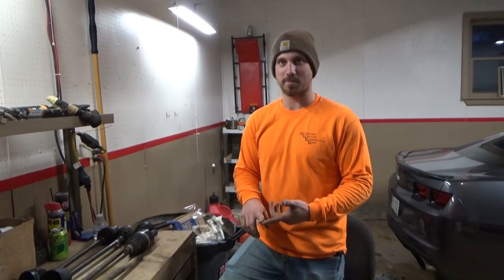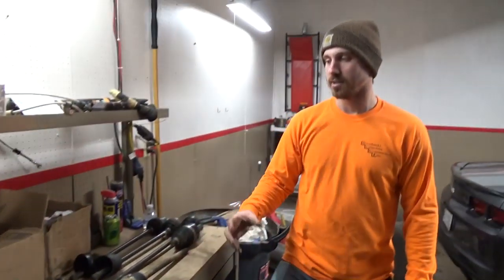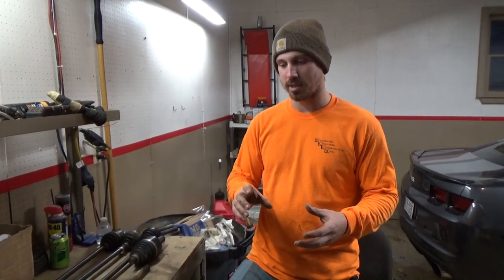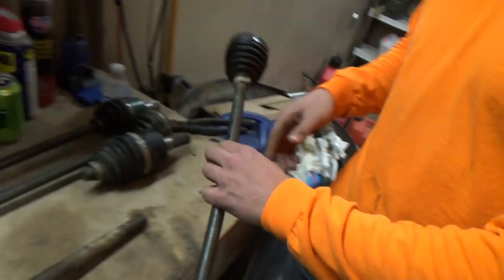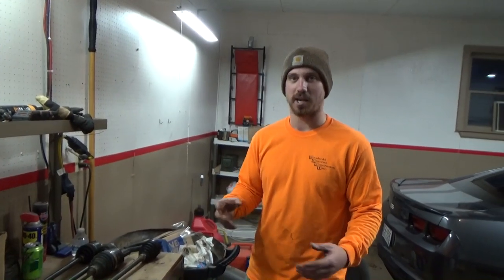To this point I've never broken an axle - my rears are still OEM stock to this day. When I pulled the fronts apart, the diff side was really hard to move. We dug in, pulled the CV apart, and there was a cage that goes around the knuckle piece - it had hairline cracks in it and was all worn. It never broke, that's why they're still complete.